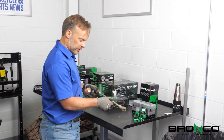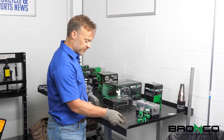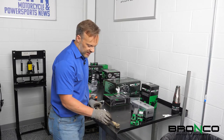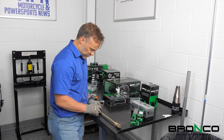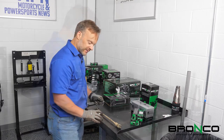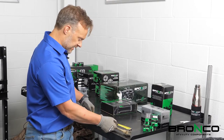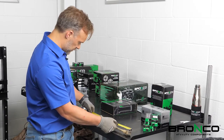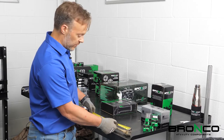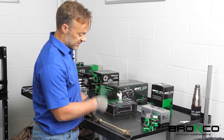Now that we've got this out, two things we're going to want to notice. First off is how these are on a little bit of an angle, so make sure we only do one end at a time so we can keep track of the angles. One thing I always like to do is take a magic marker or paint marker and mark right along here at 90 degrees from the eyelet — that way I know how they're clocked. Second, we are going to measure from the center to the center of each hole, and on this one we are really close to 14 and 1/8 inches. That is the measurement we need to have out of the tie rod end when we put the new ones on, and that should get us pretty close to straight. Let's get this apart.